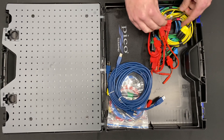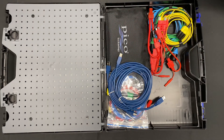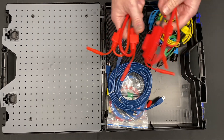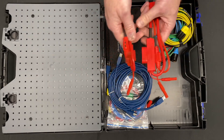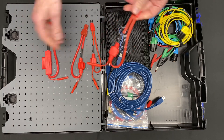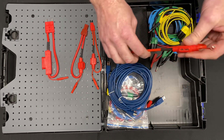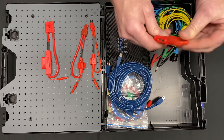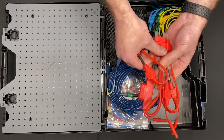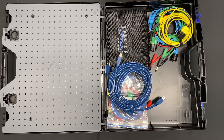Also for other coil testing, sometimes you may need to ground the coil — that lead comes in the kit as well, which is really handy. We also have fuse buddies, or fuse jumpers. You pull the fuse out of the fuse box, sit this in place of that fuse, and pop your fuse back in — so it's still protected and you've got voltage and current to test. These come in four different shapes so you can test fuse current to your heart's content.